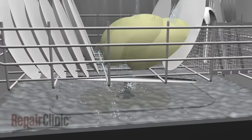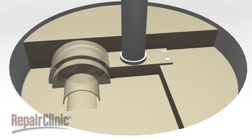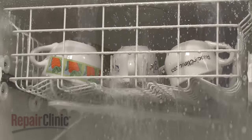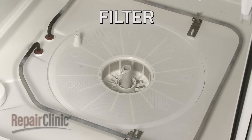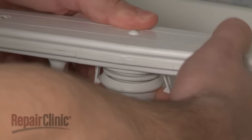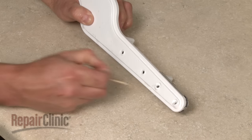The arms are driven by the water jetting out of the holes. If the arms are not rotating, or you experience poor wash performance, the cause could be a worn or damaged impeller. As the food debris is cleaned from the dishware, it collects in the sump, which filters and retains the larger particles. This filter prevents the food particles from being circulated through the wash arms. Over time, some particles may still reach the wash arms, clog the holes, and reduce wash performance, so you may need to clean out the holes periodically.